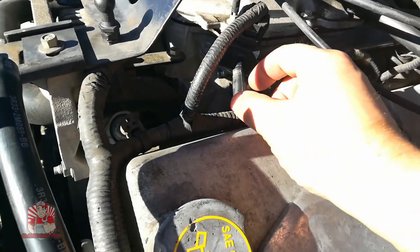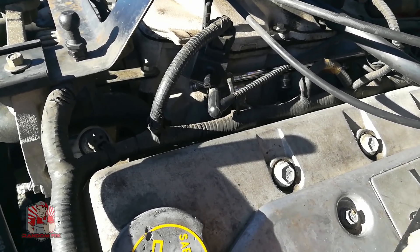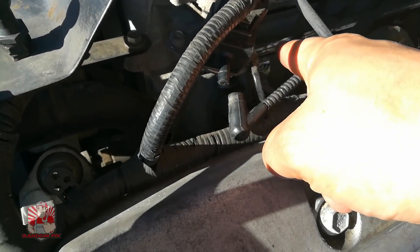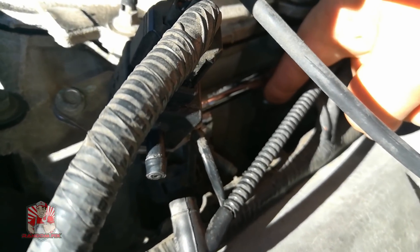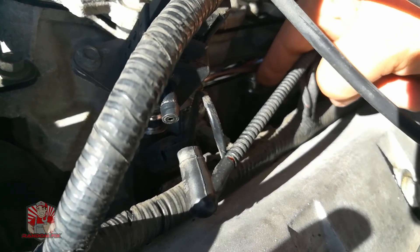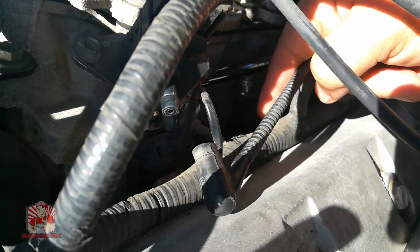The fuel pressure regulator basically keeps the fuel pressure within a certain specification — normally over 30 and under 40 psi. You don't want crazy spikes in your fuel system because the injectors, which are located underneath this rail right here and go into the cylinder head right here on top of the motor, are actually designed to work at a certain pressure. Too much pressure can actually be bad for the injector, and too little pressure will cause the same kind of misfires and random occurrences that can make troubleshooting a nightmare.